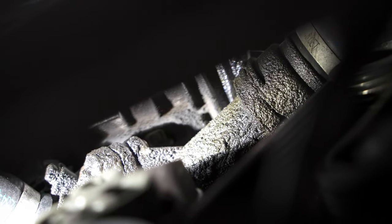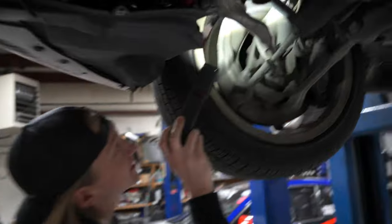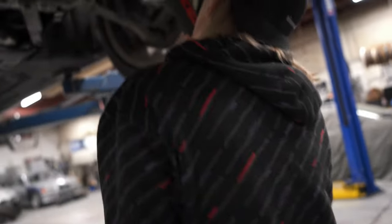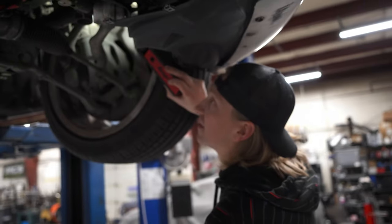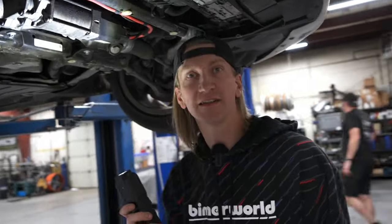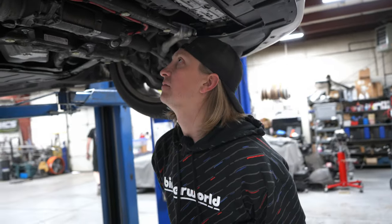It's possible there's some from the main seal — there's definitely an oil pan gasket leak. But really looking under this thing — we've got a leaky shock over here, you can see that thing is worn out. The other side is starting to leak but not as bad. So some things to address — really it's leakiness of the engine variety — but everything else looks pretty good, no big red flags.